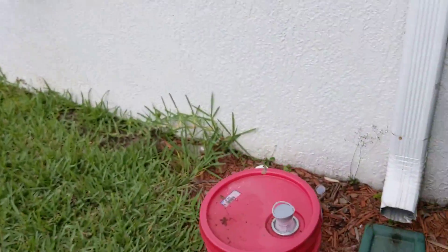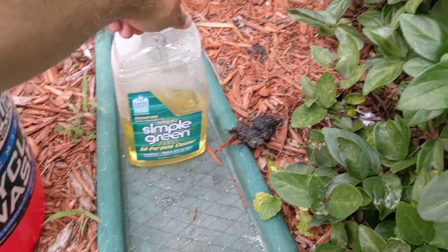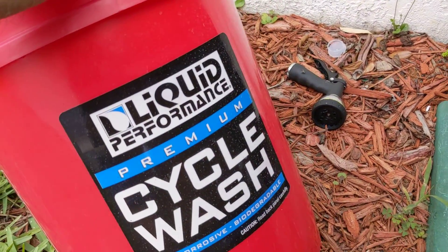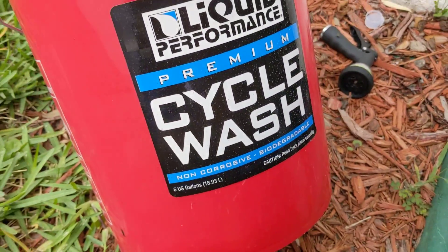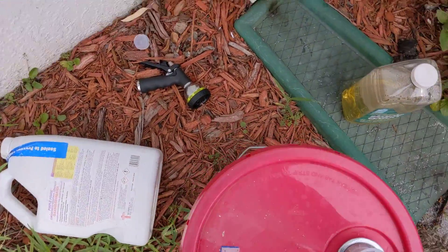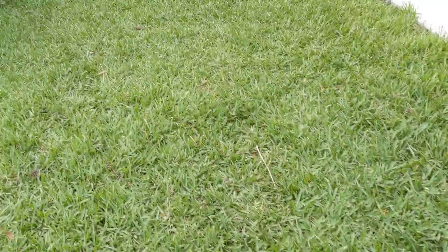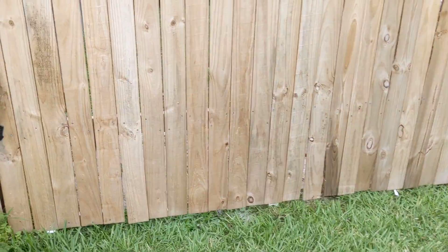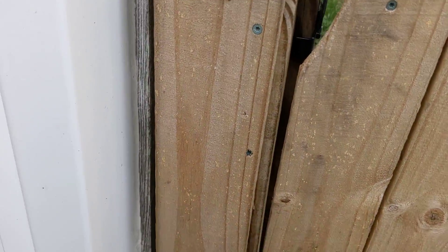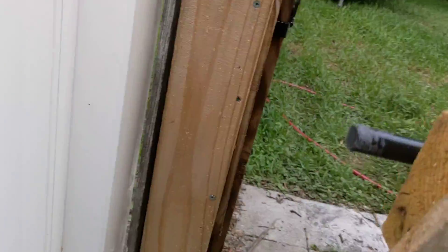Cleaners — I tried a ton of different cleaners and this is the stuff that works the best. Everyone said try the LA Awesome, try Simple Green, try Purple Power, whatever. Liquid Performance Premium — it says premium on it, you know it's good — Cycle Wash. I bought a five-gallon bucket of it because it's so good. That was like 50 bucks on Amazon. This stuff rocks. Spray it on with a pump sprayer, let it sit for like three or four minutes on the plastics. It'll melt off the dirt and it'll leave a nice shine behind. Pretty hard to beat.